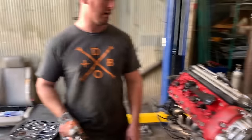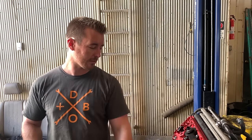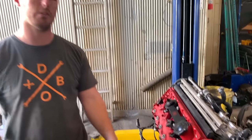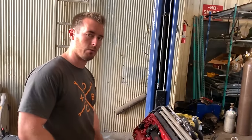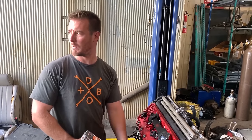It's really cool. It's got forged crank rods, 11.5:1 compression, dual VANOS, which is variable valve timing, not lift, not the same as VTEC. Coil-on-plug ignition, individual throttle bodies. I mean, these motors are super badass. They're very high strung, so they're kind of a pain in the ass to maintain. They've got manual valve tappets, which means there are no hydraulic lifters. You have to adjust the valves every 15,000 miles, I think it is.